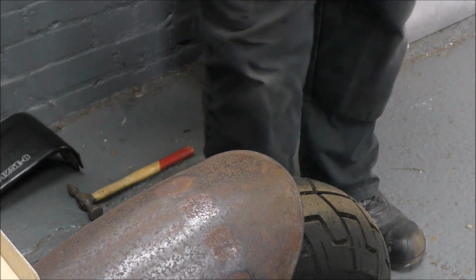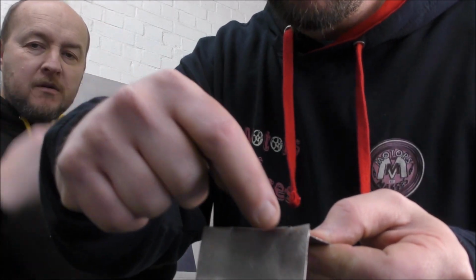Well, okay, alright. So that's all good, but what's going to stop that flexing? I know it's quite strong, but what's going to stop it flexing under bounce? Well, we can just bash some dents into the underside of this corner. Sort of strengthen it. So put a dent there and a dent there, and that will make it stronger but also stop it fatiguing. So we'll bang it in a vise and hit it with a chisel or something. Job done. Okay, right. Brilliant.